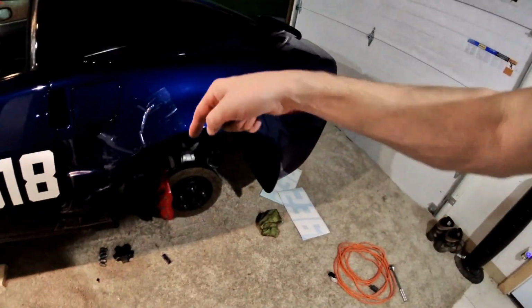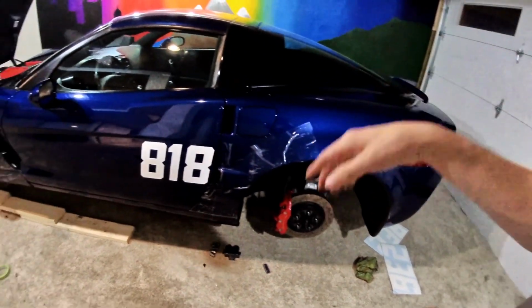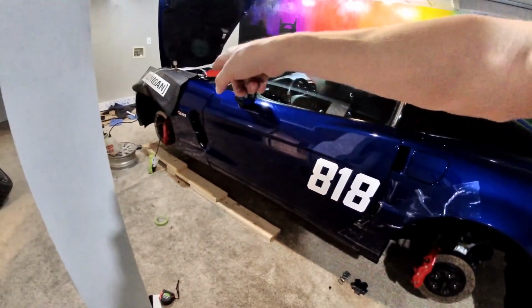I usually only go to about 8 or 10 psi. Put 8 or 10 psi in it, go around and open both rears. Once the rears have flushed out, open the fronts.